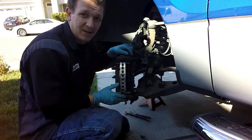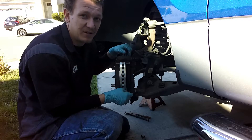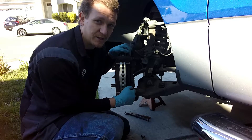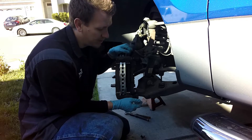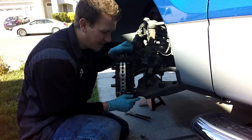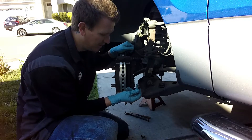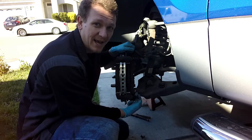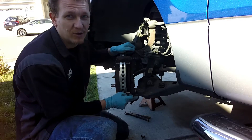When you're putting your caliper housing back together, make sure you torque everything to factory specifications. On this 2010 Ford F-150, factory specs for the caliper housing to the spindle is 186 foot-pounds. Your slider pin bolt torque is 24 to 27 foot-pounds — that's an acceptable range. These larger bolts need a half-inch or three-quarters inch torque wrench. The slider pin bolts will need a three-eighths or quarter-inch torque wrench.